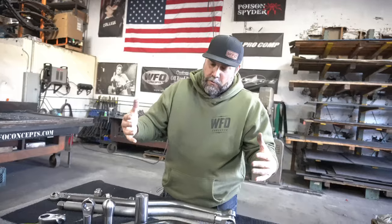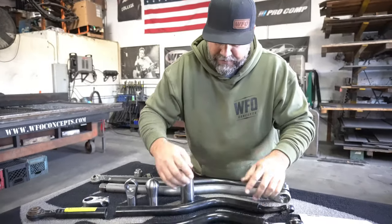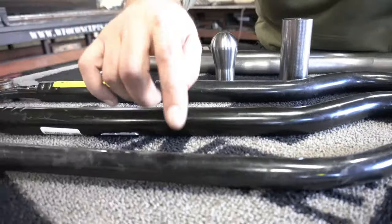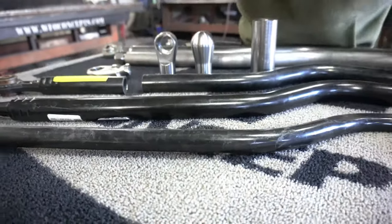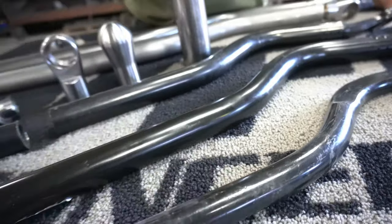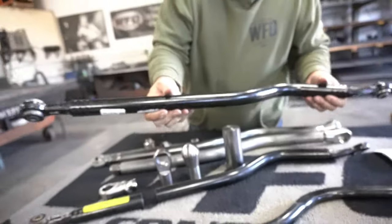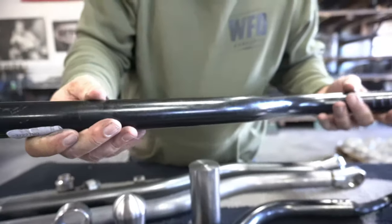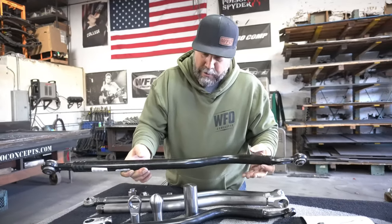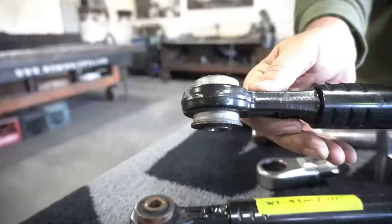Fast forward into the JL world. When they re-engineered the JL, they did a great job. Comparing the JK to the JL, the tube size is much bigger. Also, the JK was solid material, which tends to deflect and spring back — in my opinion helping cause death wobble. This JL/JT track bar is 0.177 wall, 1.42-inch diameter tubing. From an engineering standpoint, tubing doesn't deflect as much as solid material. They upped the diameter, made it hollow, and created these modular ends — and that really interests me.